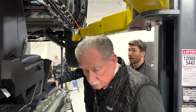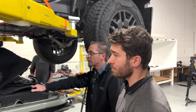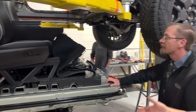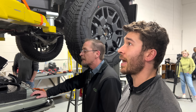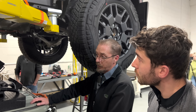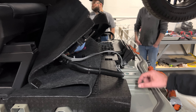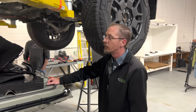This looks like a pretty natural progression from what we saw with the 4680 Model Y — we've got a lot of similar characteristics here. We've got the HVAC ducting carried here, seat brackets, seats — and to Sandy's point, this opens up a lot of opportunity for assembly efficiency. Getting the pack out and getting it in is quite a game changer relative to how we see a lot of these other packs installed. From a structural standpoint, you've got the three bolts up here, the ones along the side, a couple in the back, and the three in the front — and this is your whole floor, essentially your whole structure for the center section of the vehicle.